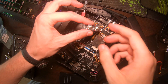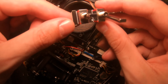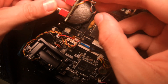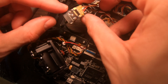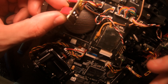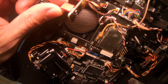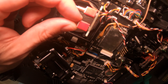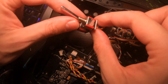If you got defective switches that have extra plastic sticking out — you can see the line here that shouldn't be there — you'll need to take some pliers and pry that off at your own risk. After doing that, they should be looking good.